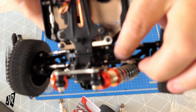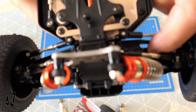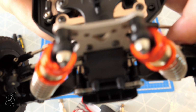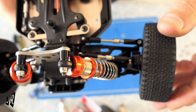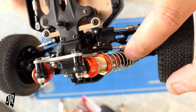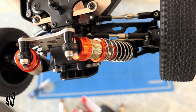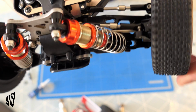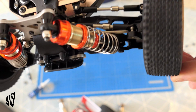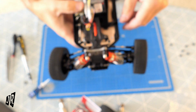if you have a look at the drive shaft here, it's not easy to see, especially if the cameras are not focusing. There we go. Watch what happens when I'm turning the drive shaft. Watch this suspension arm here. You see how the drive shaft's hitting it and actually pushing it out. That's because this drive shaft has had an impact.